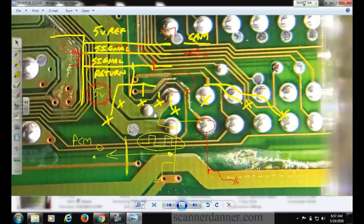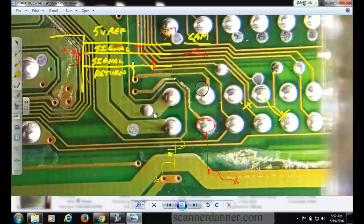Or - remember yesterday when I used my ammeter and unintentionally tried to do a voltage measurement? Is it possible he had his voltmeter connected with the positive lead in the amp port? We got a square wave signal back but the car still didn't start. We still had a spark issue. And that 3.7 volts on the reference wire is a concern we never went back to look at. 3.7 is low for a reference - I'd be okay with 4.5 or 4.6. I promise you 3.7 is too low for the reference circuit, so there's some other damage I believe.